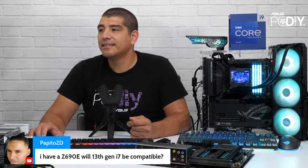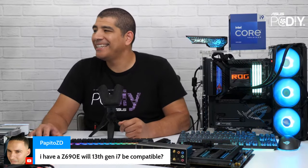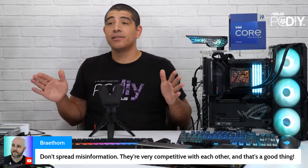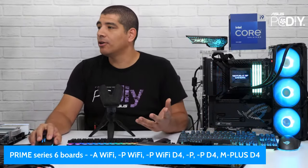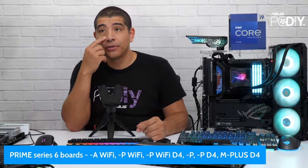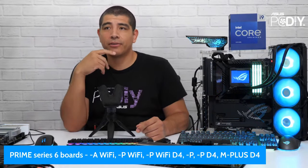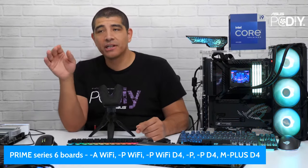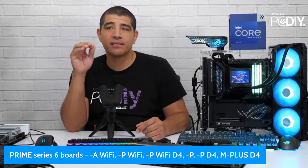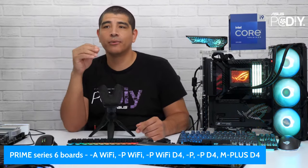I have a Z690-E, yes. Papito, ZD, you're good. Any of our Z690 series motherboards and B660 series motherboards, they're 100% all good to go. So you just have to download the newer UEFI BIOS. We already have those available, and you can essentially drop in a 13th gen series processor. So if you have Z690, they are 100% compatible. You can get a great experience, stock or overclocked, from any one of our Z690 series motherboards. You don't have to worry about it in that regard.